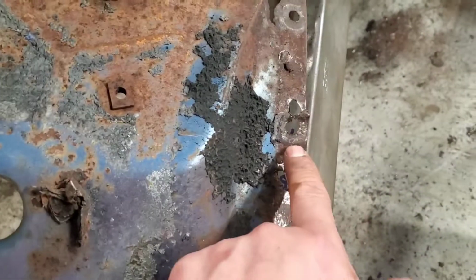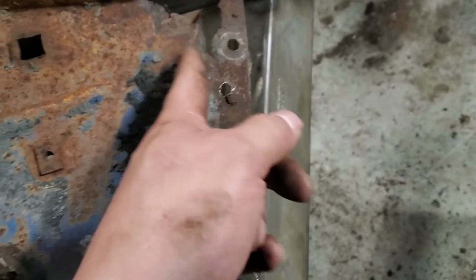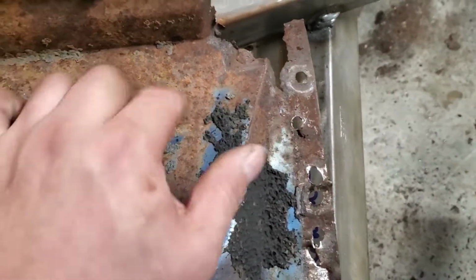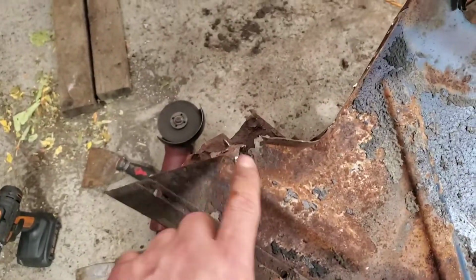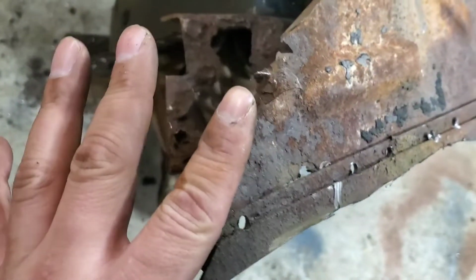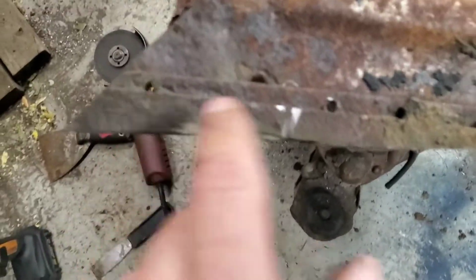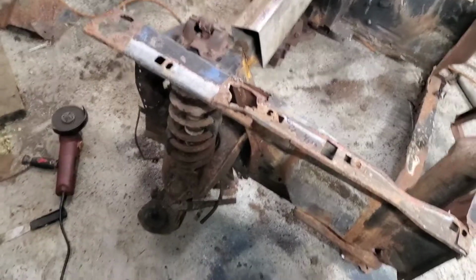Alright, so we have some on the apron, so here it is, and like I was saying, I kind of wasn't able to get all the spot welds correctly, so chisel and hammer caused some damage, but ultimately we're going to replace this anyway and add some fresh metal on here. And again, we're going to have to redo this and then see what we could do over here. I don't want to get rid of all the original paint, but we do want to make it solid. So over here we need some patch work because this should be a flange that comes out this way and then attaches to the fender or firewall extension drop off, and so on and so on. So I'm going to work on getting these guys out, and then we'll be able to see what it looks like on the car.